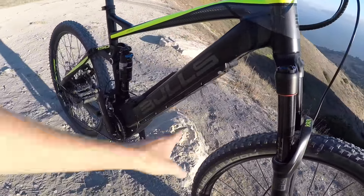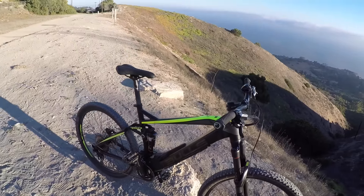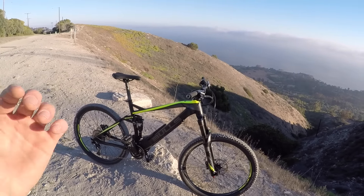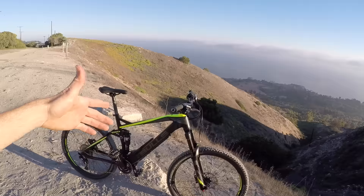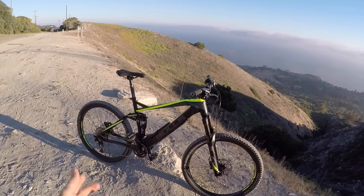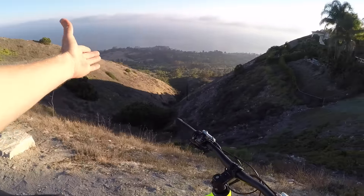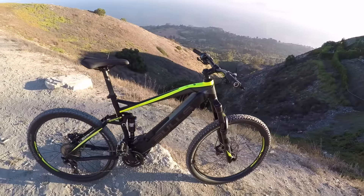The battery pack is really a superstar here — 37 volts, 17.5 amp hours. If you want a bike that's going to go the distance in an off-road mountain style versus a commuter, this is a great choice. They estimate 137 miles per charge in ideal conditions with a 170 pound rider on flat pavement. Realistically, maybe 35 to 40 miles at the low end if you're a heavier rider going up mountains at the highest assist level — but it's nice to have those extra watt hours.